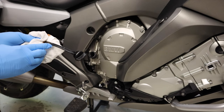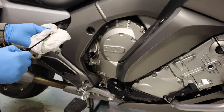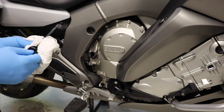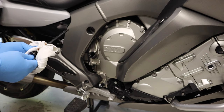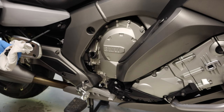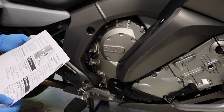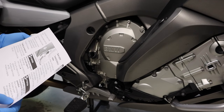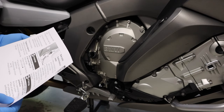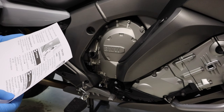So my oil level is totally okay and this bike hasn't consumed oil almost at all during my trip. Now I know for sure that there's enough oil to continue with this bike. If the oil level is below the minimum mark, top up the engine oil — but it's not, so I'm not going to top up. If the oil level is above the max mark it needs to be taken away somehow. And the last step here is to install the oil dipstick.